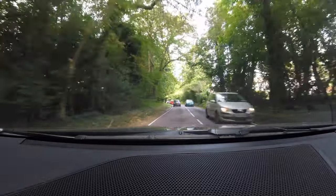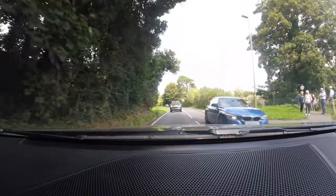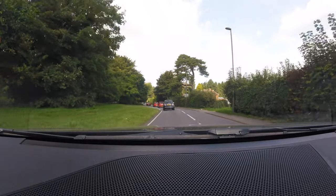If you bought the car just for the engine and got it with Business Nav like I did, shout out to Defined Coding — they helped me source a screen. I've gone for the 8.8-inch Pro Nav screen, the wider one. It's not a touchscreen but it gives you a full display and can do split screen. Carl will code it to tell the head unit you now have a wider screen — without coding it'll just say no signal. Make sure you get the correct one as there are different versions.